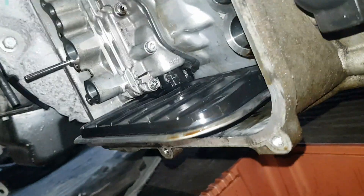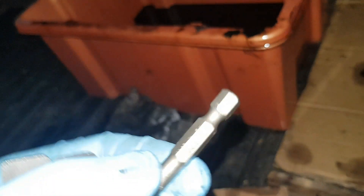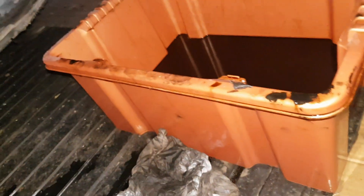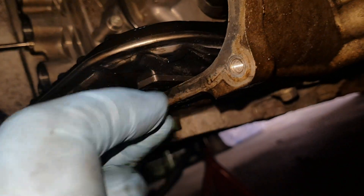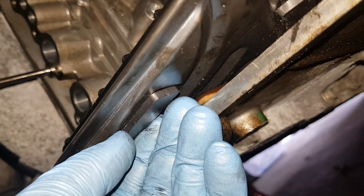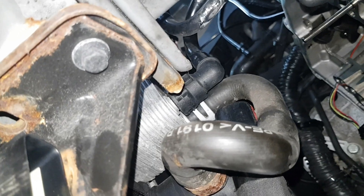One last thing - once you've got the filter in and secured with that little T27 bolt, don't forget about the magnets. I took them off because the less things you have underneath the filter the further you can bend it down. One goes here, and the other one goes just there - don't forget about them because they are very important, especially in this gearbox. Now it's time to take the heat exchanger / oil cooler - however you want to call it - and wash that inside as well.